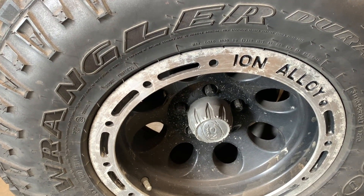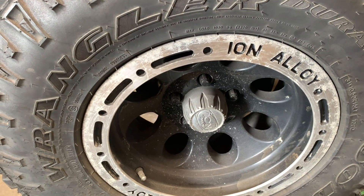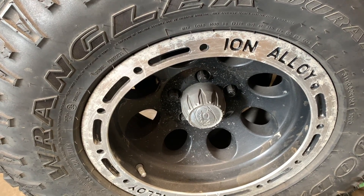The clamp force is related to bolt torque, but only loosely — so just because you torqued it down to the proper spec doesn't mean you've achieved the proper clamping force. There are many variables: for example, if there's dirt or rust between your wheel and hub, you may not get the coefficient of friction needed, as it can act almost like a lubricant. Also, if your studs are dirty when you torque them, that extra friction means even though your torque wrench reads, say, 100 pounds, you may not actually have that load on the stud itself.